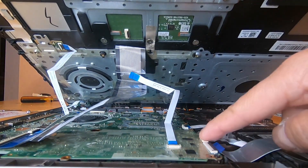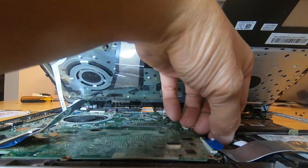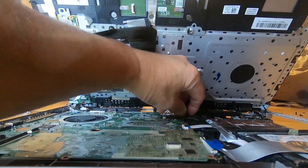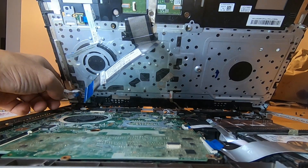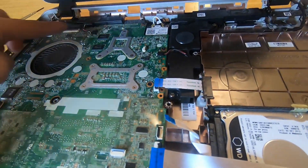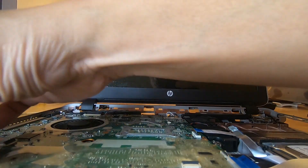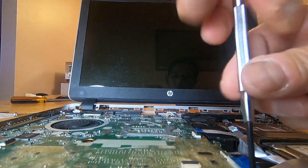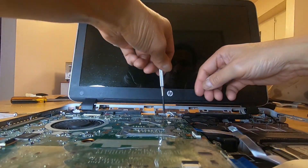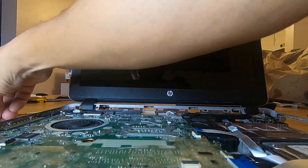Like I said, it's very involved. There are a lot of ribbon cables attached to the top cover. You need to access the memory, which is under the motherboard of all places. Once we have the ribbon cables taken out, we can proceed to take out the screws that hold down the motherboard to the back panel. The RAM is under this board, which is kind of weird and difficult. This upgrade is, like I said, very involved.